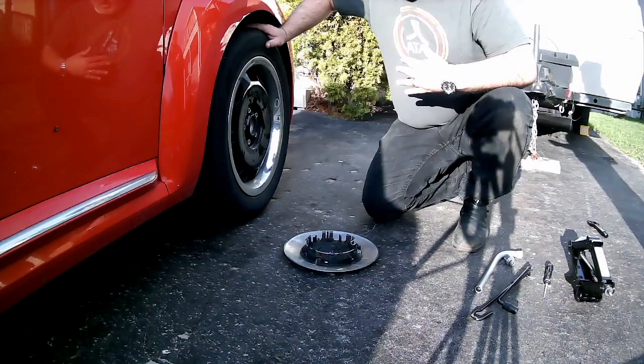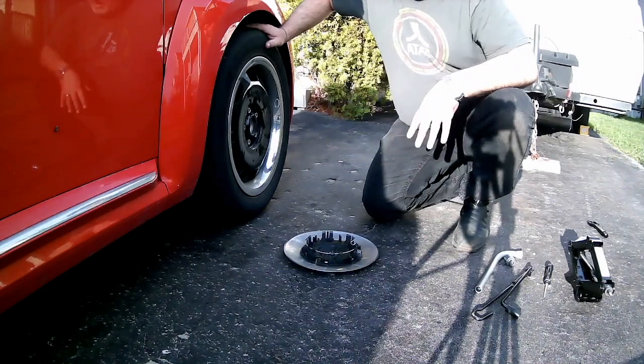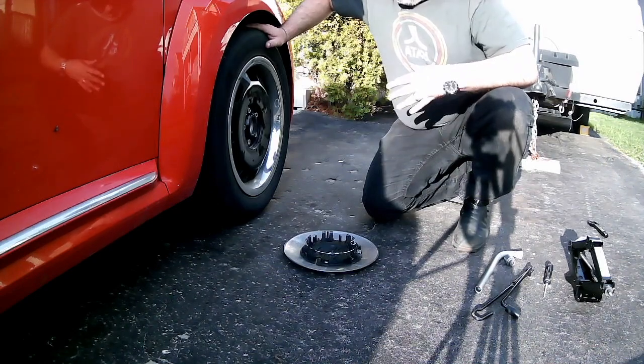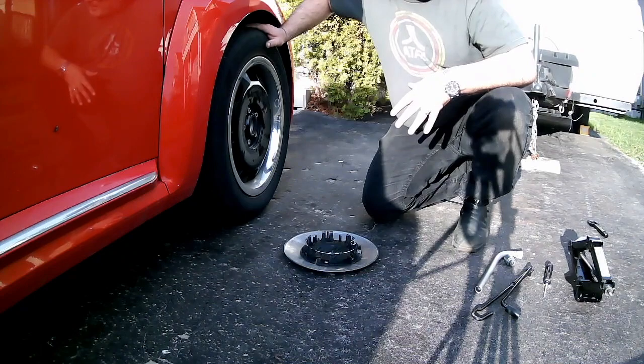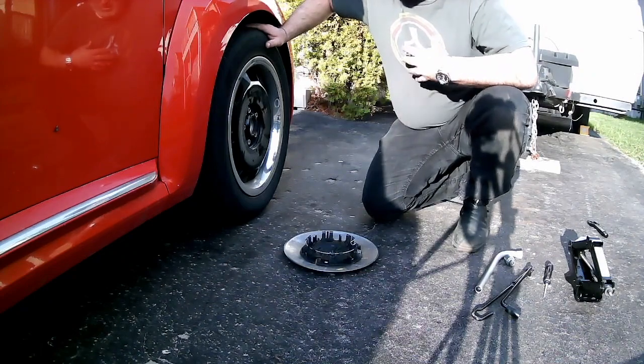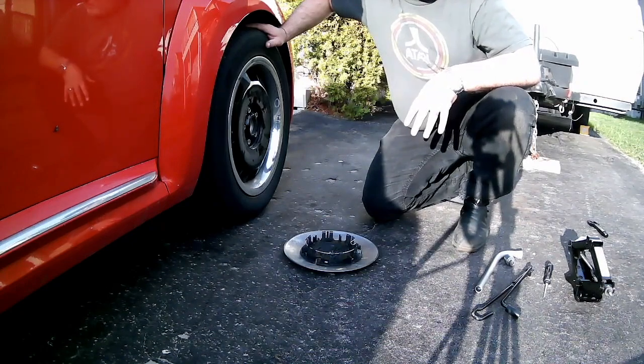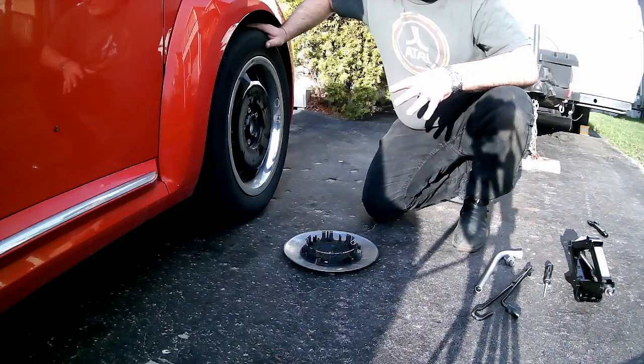There's a speed written on the temporary tire or on the donut that you're not allowed to go faster than. It's usually 40 or 45 miles an hour. Respect that limit. It is not designed for long-term use. It's not designed for high-speed use. If the road conditions are wet or snowy, you need to reduce your speed even more. That's really important for safety.